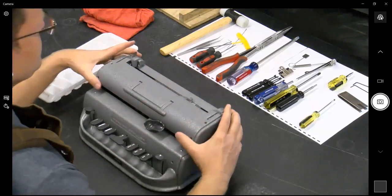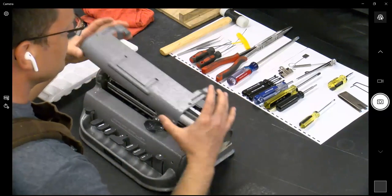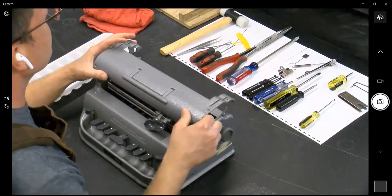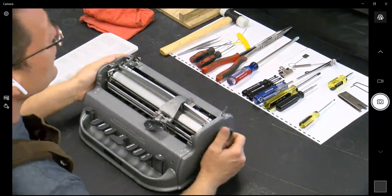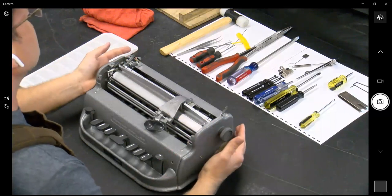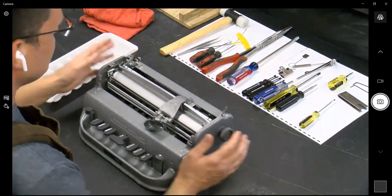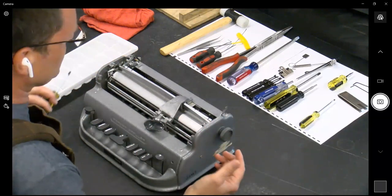When you take the top plate off, before you go shaking it around, make sure the levers here haven't gotten bent — that may cause a little friction getting the plate out. As we start opening up these plates, look for possible damage to the brailler, because it gives you perspective before you start getting into things that may be a more serious problem. Sometimes it can be a little more than just cleaning.